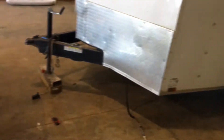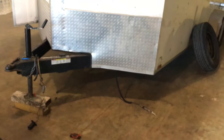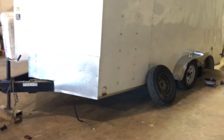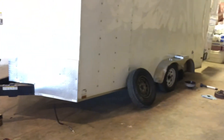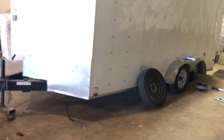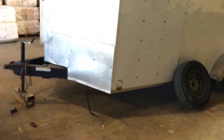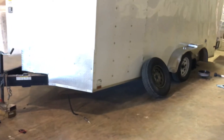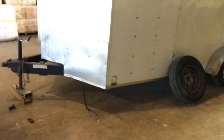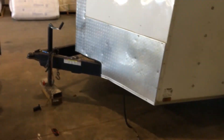We may not have hub failures on the other three, but we definitely have heat-damaged components all the way around — from that simple mistake. It's terrible damage caused by something as simple as getting the plug body upside down, but it can cause hundreds of dollars of damage. That's why I tell folks: it's impossible to know what's going on over the telephone. We need to get out, do some investigating, and get to the bottom of why things happened. Don't be so quick to jump on your technician — most of us aren't doing sloppy work.